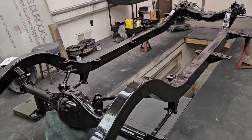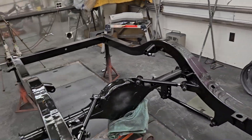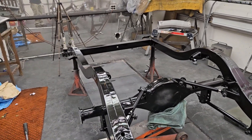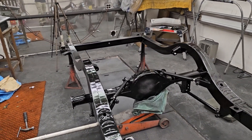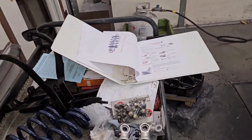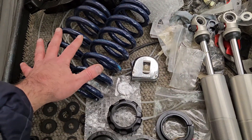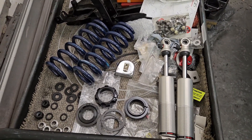So once you've pinned in the washer, start the lock nut. That one's started, and that's what we're doing — going through, putting the spacers, the bolts, the lock nuts, and the washers on each one until this is located. That part went actually really smooth. So next we'll look at some shocks to act as limiters, and then probably clean up for the center section. Digging everything out, we even found the instructions that came from Ride Tech. Here are our rears, here are our springs, and all of that stuff turns them into coilovers.